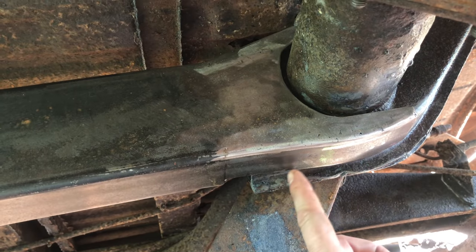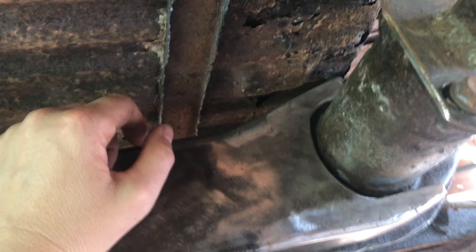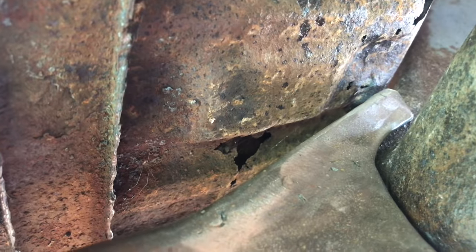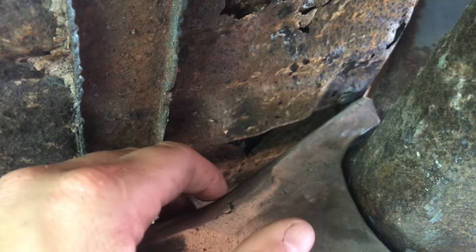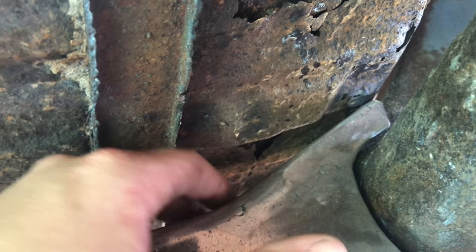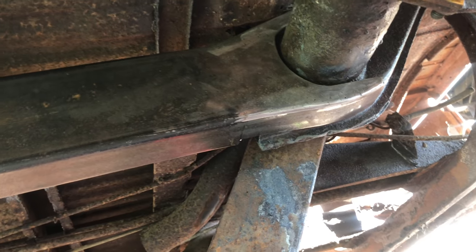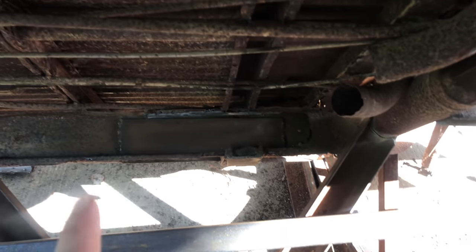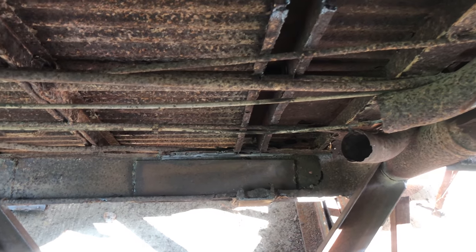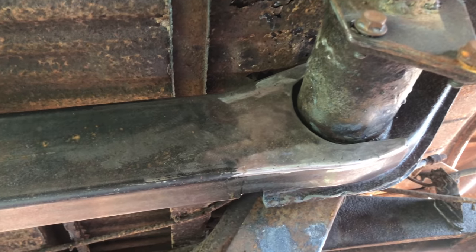I'm going to drill some holes here to plug weld and drill some holes on the top as well to do the same thing. I'll have to cut a hole in the floor - I don't think that floor is salvageable, but everything's salvageable, right? So we'll cut a hole in that with the plasma cutter and plug weld up here as well. Obviously I'm going to have to turn the bus in order to do that, so this is not going to be just a one-hour project. Then once we get it turned over, we'll go ahead and make this lower piece down here and get it welded in. So let me get that off of there, get those holes drilled kind of where I think I'm going to want those, come out here with a sharpie and mark those out and we'll try and get that piece in.